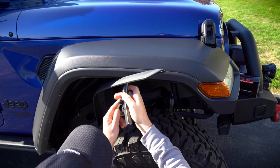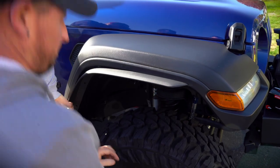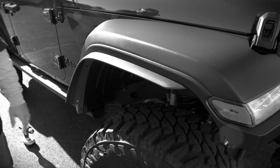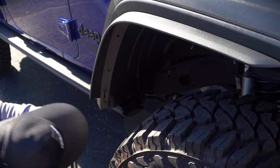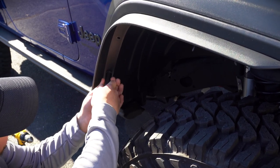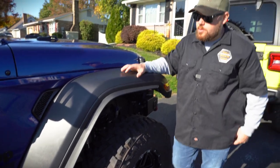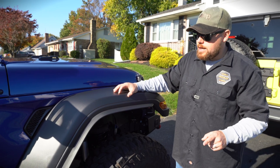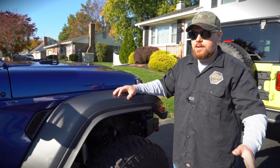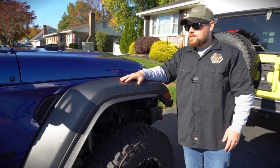Here's the moment of truth — Dave's going to get it on. With just one rivet in, let's see if it holds — that's the strength test. In just a couple of minutes your Jeep could look like an Extreme Recon build. Dave's got it installed with six rivets in; there are three more holes to drill. The nice thing is you can use all six to align it in the right spot, then drill those remaining three. We'll let you know the drill bit size. Just snip off the ends of the rivets when done — this already looks great.